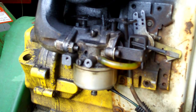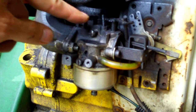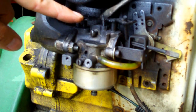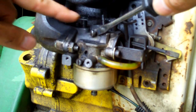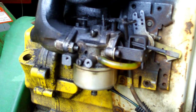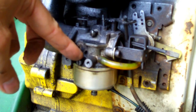That's the function of the idle screw. You can tell it's the idle screw because it acts as a stop — when the throttle closes, there's a tab that comes to rest against the end of the screw. That's your idle screw: it affects how far the throttle opens and closes at idle.